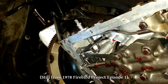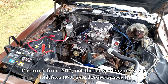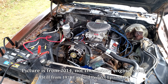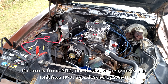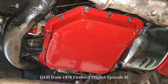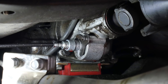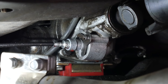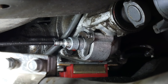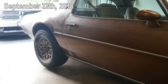It also has a BOP-style tail shaft housing, which is most likely how the car would have been equipped from the factory since it came with a Chevy 305 small block. My understanding is that even for this combination, where they use a Chevy-style bell housing, they would still use the BOP-style tail shaft. Either way, the speedometer cables are compatible between the two, and from a visual examination we can see the seal is leaking at the cable — most likely the shaft seal has failed again. We'll have to disconnect that cable and remove the housing to get a better look.